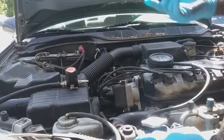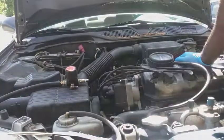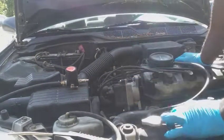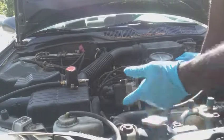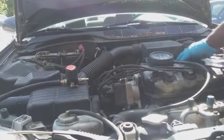This is a pretty simple fix — just diagnose the coolant system's ability to hold pressure, find the leak, repair it, and it's holding pressure fine now. The original complaint of overheating or losing coolant — it explains it. Peace.